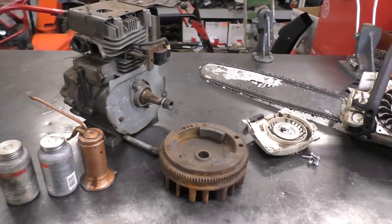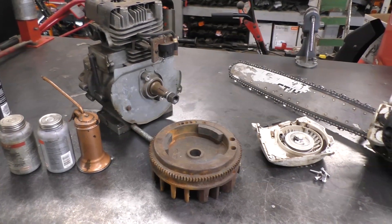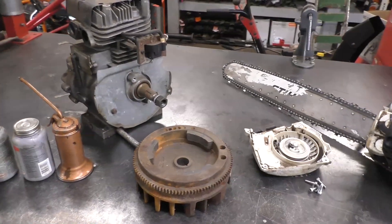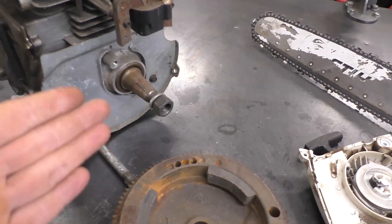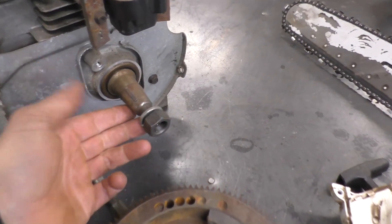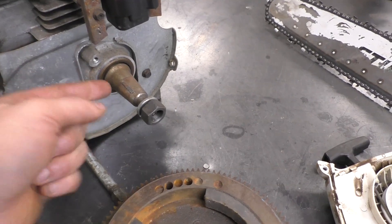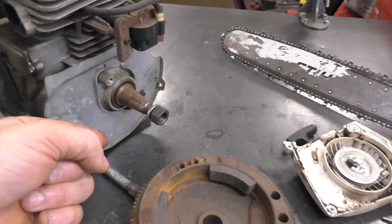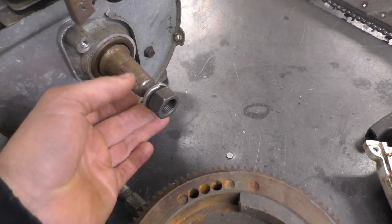To re-emphasize: you have to get a good lock when you put on the flywheel — that's the whole purpose of the tapered shaft. You'll also notice on generators, when you take off the armature, it goes onto the engine on a tapered shaft just like this. So it would be the same thing on a generator — don't put anti-seize when you put the electrical armature back on either. It's also really important to make sure your flywheel nut is torqued properly.